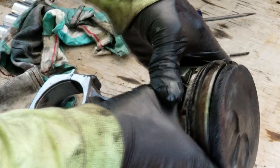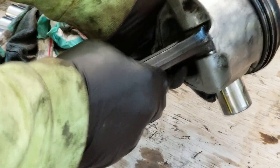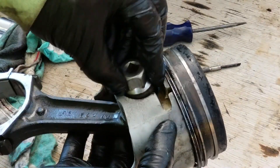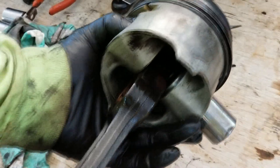I was hoping that pin would slide right out, but yeah, she's going — she just pushes right out of there. You don't have to get it all the way out, you just need to get it past the point of the rod. If this doesn't work, get a large spark plug socket and slide it right in there and use a hammer to bang it out. Get another large socket on the other side, or just prop it up so there's room for the pin to fall out. It's pretty easy — the rod just comes right out of there.